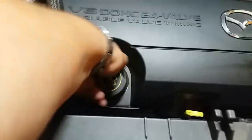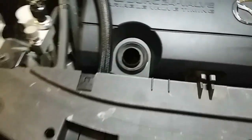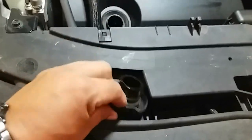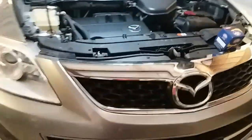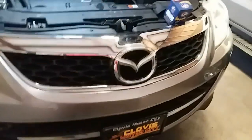What we're going to do is open up this oil intake cap — where you pour the oil in. By removing the cap before we lift it, we're able to drain the oil a lot faster because it's able to breathe, so it doesn't gurgle or take a long time to drain out. That way it just flows out.